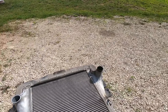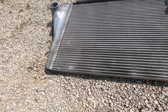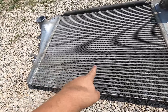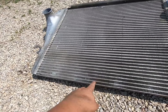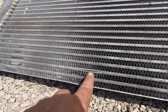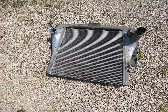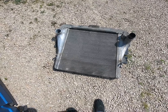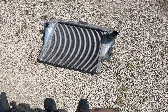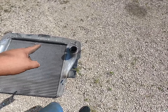This thing had a massive air leak — no need to pressure test it at all. Right here is where it is: this is the backside of the charge air that faces the radiator. See this tube is split wide open — it's a failure of that whole tube. You could hear it, you could feel it with your hand. It's also cracked on the other side, the front side facing away from the radiator. So it's getting replaced.